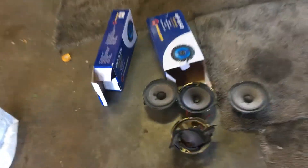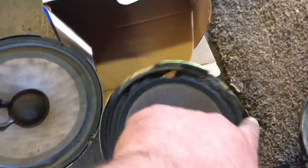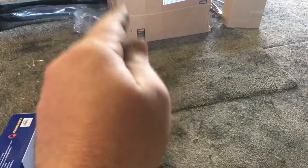In the back, you don't need to take the housing off of the door — it can stay on. Just unscrew the speaker from the housing, clip the wires, pull it out, and then there's a plastic ring around the outside of the speaker on the front of it. You want to peel that ring off. It's going to be a ring that goes around the outside edge of the speaker. It's glued to it. You're going to want to pry it off and then flip it upside down and screw it back to the housing. That's going to act as a spacer to space the speaker out far enough away from the door so the magnet doesn't hit the door.